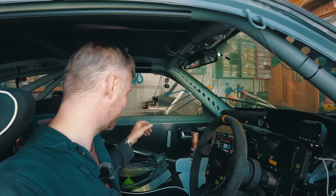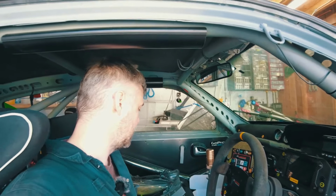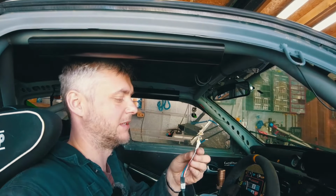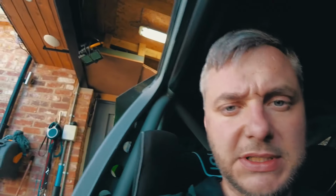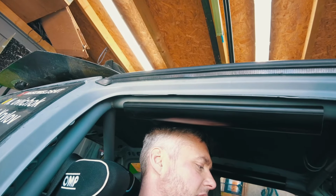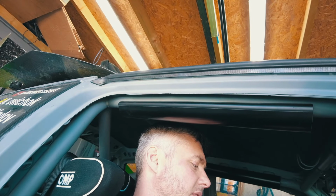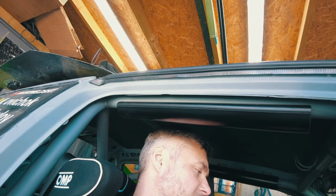We have it fitted. Now the ever so exciting part of wiring all of this. It has 6 wires. As I mentioned before, this is CAN bus harness. So we have CAN low, CAN high, then we have ground, and we have permanent live or switch live, ECU.